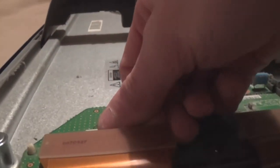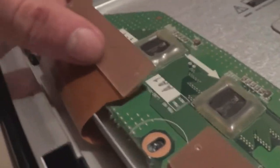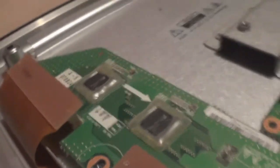You want to be very careful when removing these connectors. Some people grab them from the corner and just literally yank them out, and of course it rips very easily at the tab where the plastic is. To remove these you just go to one corner and pry it up very slowly. Normally you can just pull it out like that. You don't want to be yanking up on one corner so it's half in and half out - that's how you rip the connector off.